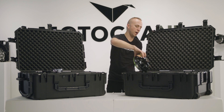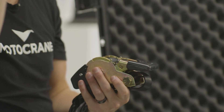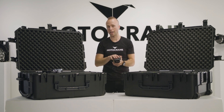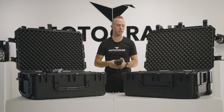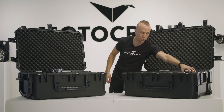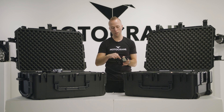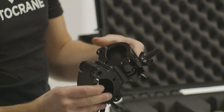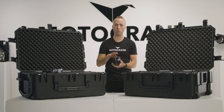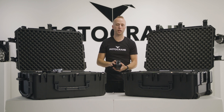The clamp articulates around the handle and gives you a solid point at each corner of the grid to fix to the roof. Once you have the grid built using the four suction cups, we also provide two 2,000-pound-rated ratchets for securing the grid through the cabin of the vehicle, providing positive interference so you're never relying on suction alone. The ratchets do a lot of the heavy lifting, putting the load through the roof rails rather than the flexible roof skin. We also include four fixed 90-degree speed rail clamps for one-and-a-half inch speed rail — worked with the manufacturer to place a big fat bead along the perimeter so they're built for cantilever load. We use these primarily for building dual rail setups, going from a single piece of flat speed rail to two vertical rails for rigging the SRB.